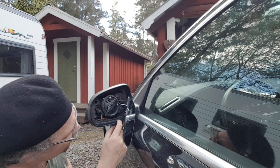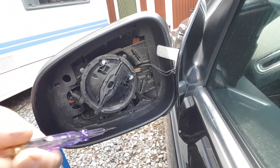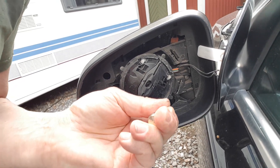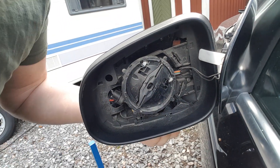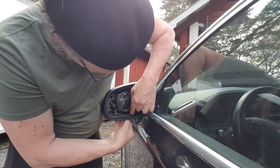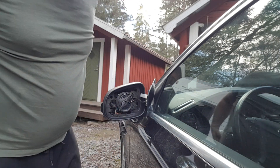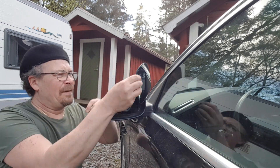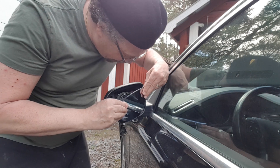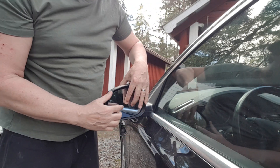Now I'm going to show you some more close-up. What I'm going to do here is aim for this small gap, press it down — now it's loose. I think I need both hands for this. Press it straight down and then a bit, and it's done. Now I can put this mirror back because there's no need to have it hanging and breaking the wires. You have small gaps here — just check the white pins, and they're fitted. Just press straight.